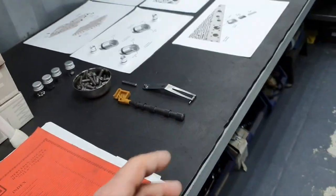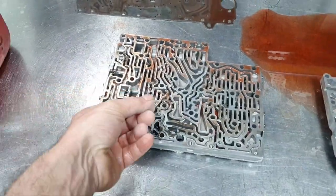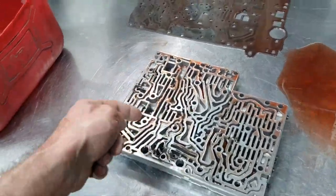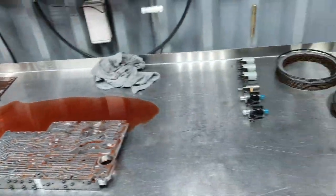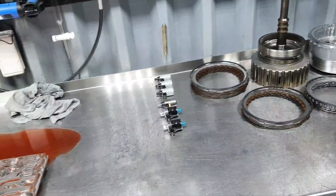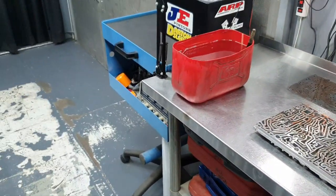If you force it, or if it doesn't have fluid, if you have passed it through the petrol and then you force it somehow, you're not going to have a happy end. You're going to scratch either the housing or the solenoid valve itself. Classic. I don't remember if I mentioned I have to measure the resistance of each solenoid with a multimeter. I also need the O-rings. I don't have the O-rings, and I don't have more things.